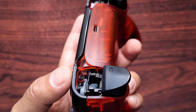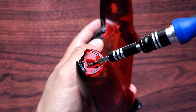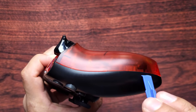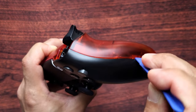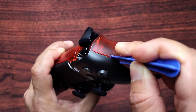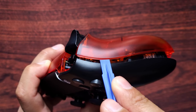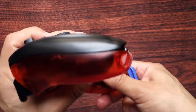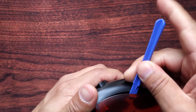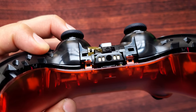You're going to have four screws to take out. To remove your back shell, on one side dig in with your prying tool and just keep going back and forth all the way up. There are locks around this area, so you'll know when you've opened up that side. Then move onto the other side and do the same thing. If you had already pushed those locks outwards, it'll make it easier for the back shell to come off.